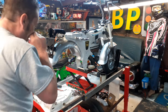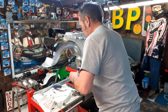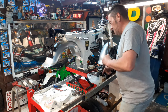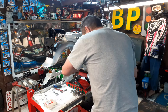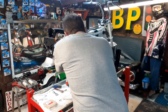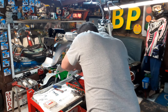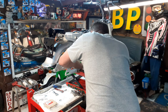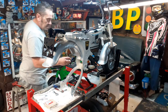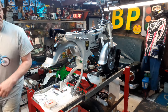Right, let's put the swinging arm on. Again, put the grease on — should be a bolt in there somewhere. I'm using conventional grease. Sometimes when you're doing powder coating you get an extra layer and there have been a couple of patches where I've had to file them away a little bit. There you go, let's get that on. Tighten that up in a second.